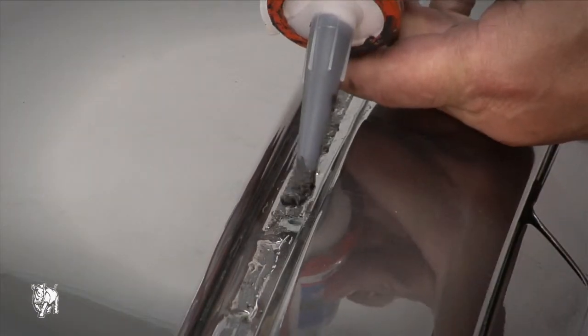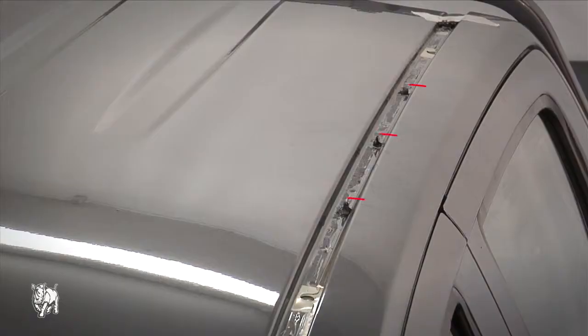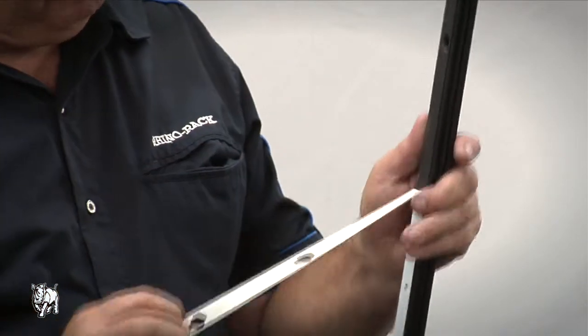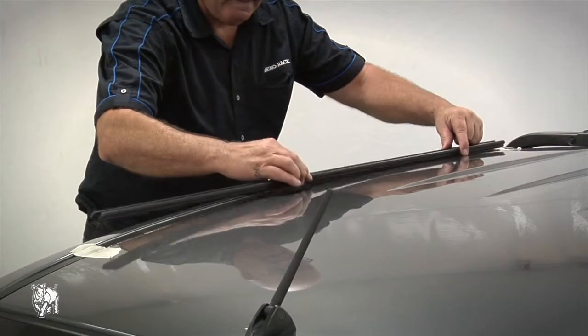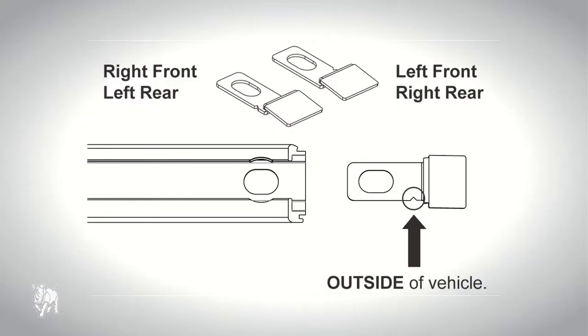Apply a liberal amount of Shelly's butyl mastic in and around each hole, including the threaded M8 inserts. This is an important step for waterproofing the roof area. Peel the white backing strip off the track foam tape, then position the track on the roof. Insert the end caps at the end of each track and ensure that the profile of the end cap matches the ends as shown.